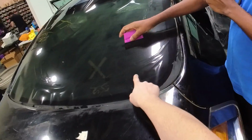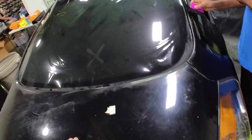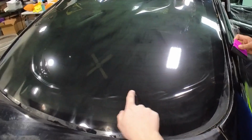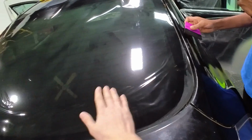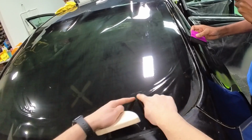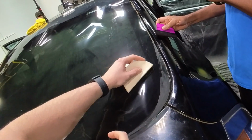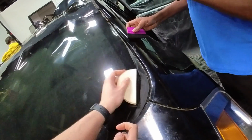Yeah, so this is totally normal and actually looks perfect. When you're working with glass that has some bow to it and kind of curves in here, and you get these waves, you want to match up your card. As the film pulls tight, we're going to just push this forward more, and you're going to watch this corner get completely readjusted.